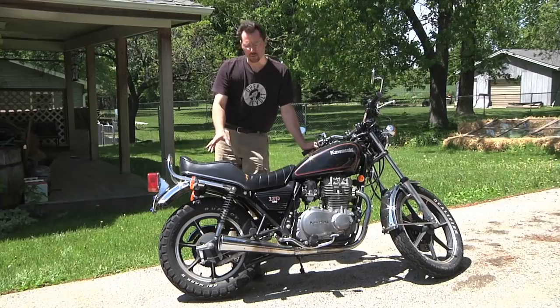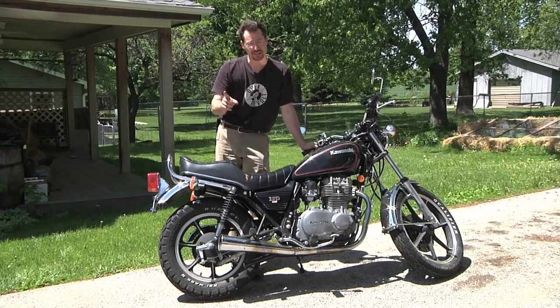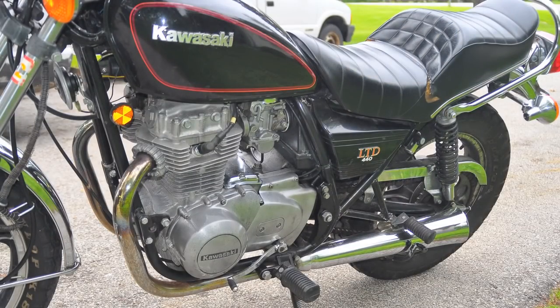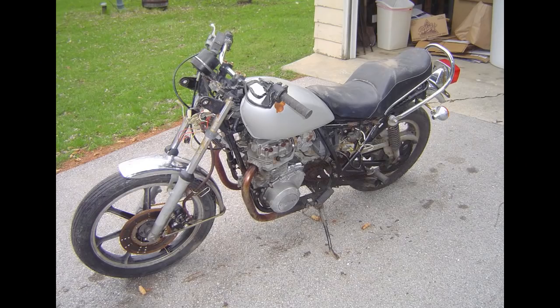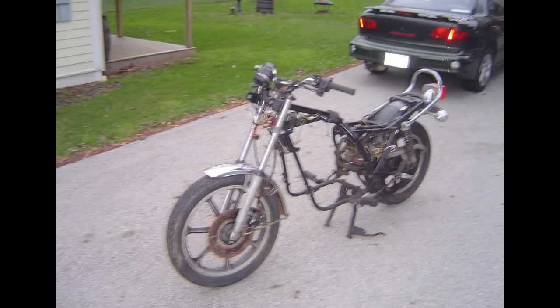So overall I think this would make a pretty good motorcycle candidate for an electric conversion. This one happens to be a 1981 Kawasaki KZ 440 — the exact same make, model, and year as the motorcycle I'm going to convert to electric. Before we start the conversion by removing the engine and transmission, there's one more thing we need to do: mark where the output gear of the transmission is compared to the frame. Using a grease pencil or silver marker directly on the frame will show us where we need to later mount the electric motor so the chain, rear suspension, and drive sprocket all line up. Once that's done, you can drain and remove the gas tank, then remove the engine and transmission and sell them, leaving you with a plain frame ready for the electrical components.